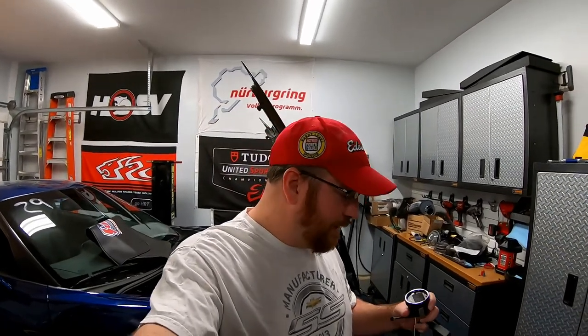The car really has no way to tell you much besides oil pressure, temperature - I don't think it shows trans temp - and engine coolant temp, you know, all the basics. So I needed something that could tie in both aftermarket gauges and fuel pressure regulator stuff, as well as tell me what's going on in the stock computer. So I found this product called an AeroForce Interceptor.